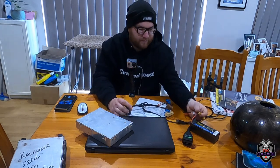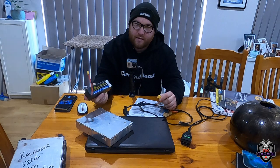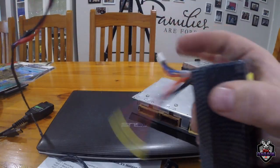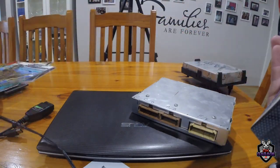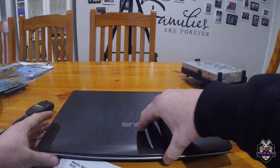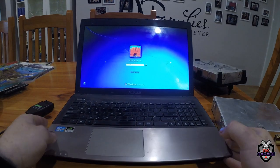To get it powered up, I've just used an RC car battery for now — a 3S LiPo which runs at about 11.1 volts, but usually 11.4 to 11.8 when fully charged. This works fine. Just plug the connectors in, the ECU turns on — happy days. I'll plug that in, get the laptop back up, and show you guys everything connecting.